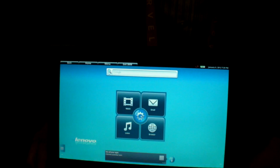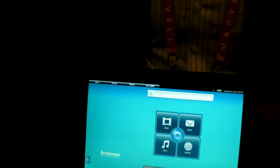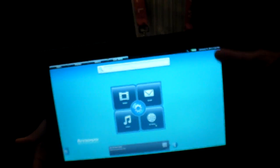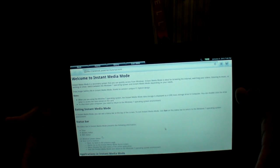Is it similar to some other tablets or hybrids released — like in China? In China you may be referring to the U1 product. It's similar in the sense that you have two different modes, but this one stands apart because it has full i7 powered performance on the Windows side and then a very low powered but efficient instant media mode using a Qualcomm Snapdragon processor.